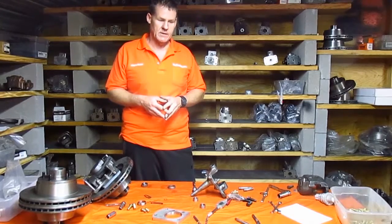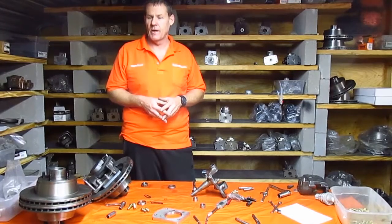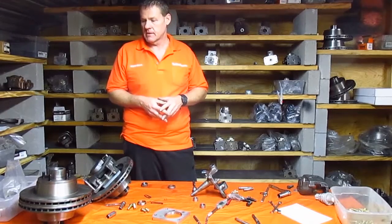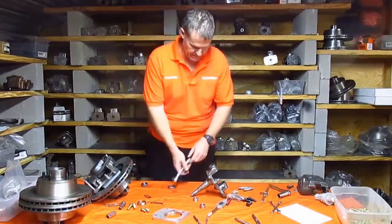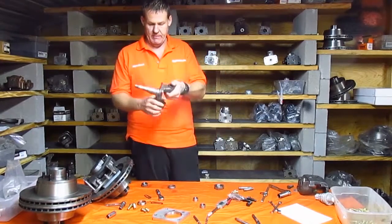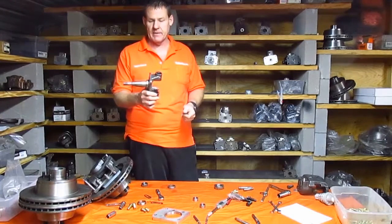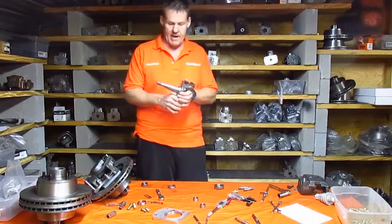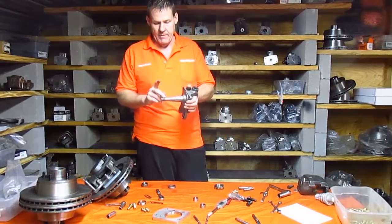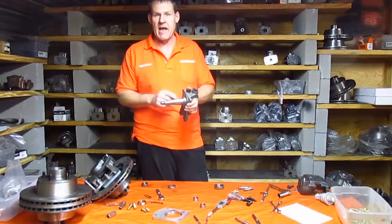What we did was we figured out how to get the late 70s original Chrysler large rotor sliding caliper system on the original spindle. What we have here is a Dodge truck spindle. These were basically unchanged from about 1948 to about 1971. They typically have an A3 and A5 bearing, or an A2 and an A5 bearing.